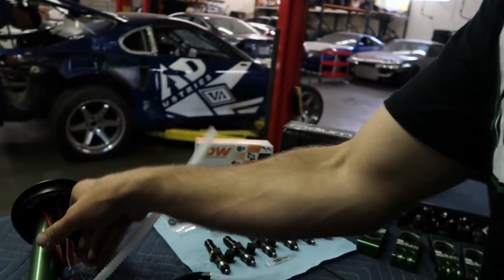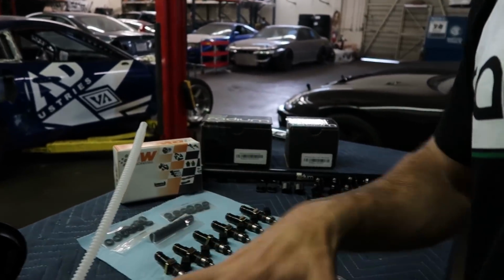And in the bottom of a tank in a Supra, there's a little pickup. It's like a Toyota's quick little solution to sloshing fuel, so your pump always has a little bit of fuel to grab from, even on a couple G-force corner or whatever, like a longer corner that's pulling fuel to one side. Obviously a Supra can't pull multiple G-forces, but you guys get what I'm saying.